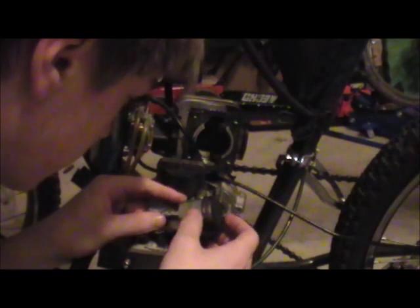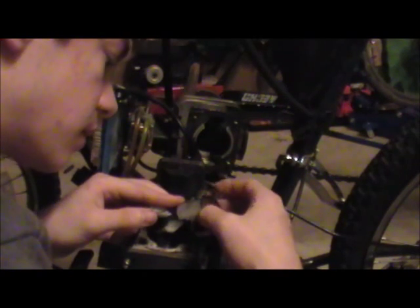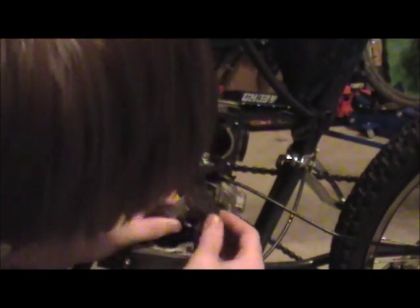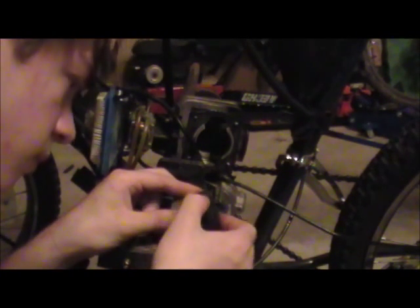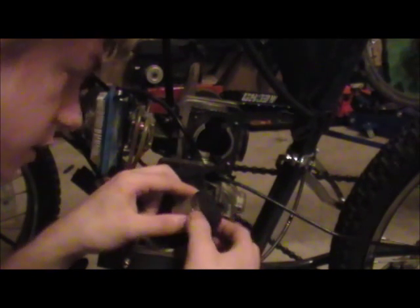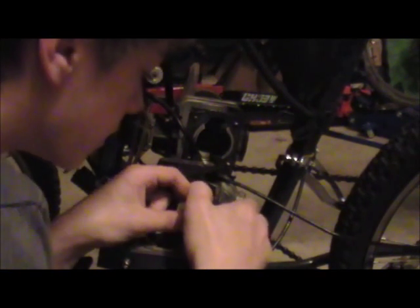A piston. I'm gonna wire brush that and the rings. Everything looks decent. There's some little bit that looks kind of like pitting here but that's alright. These rings look great but this just has terrible compression so they're worn out.